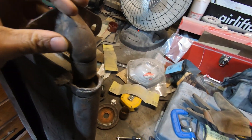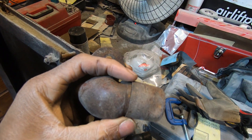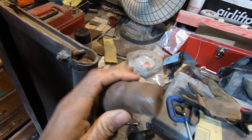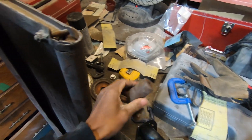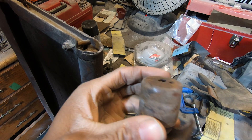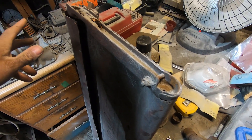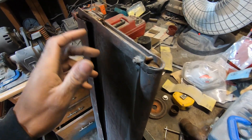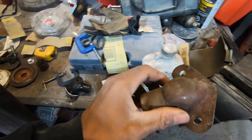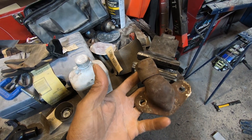I put this piece into the hoop and it stuck and was in a bind. Unfortunately I can't get it off easily, so that's what we're going to start with today - getting this off and then scrapping that hinge and using the new hinge. Ideally all I have to do is get this off, straighten it out a little bit, and weld these two pieces to the end of the tailgate. I think I'm going to end up having to fiddle with it quite a bit. First I'm going to jam it in the vise and try to get this off.